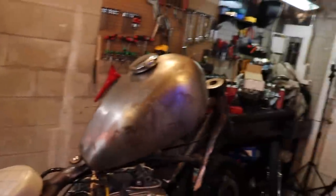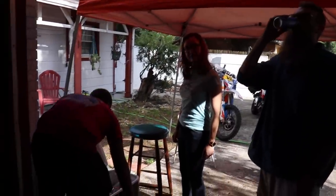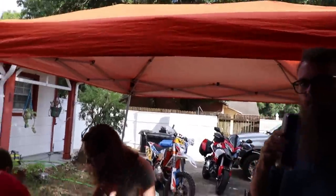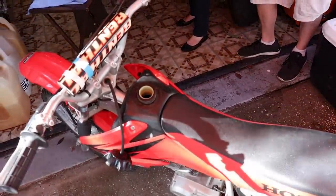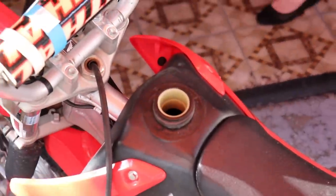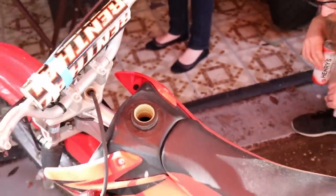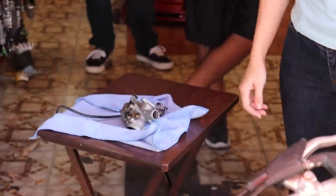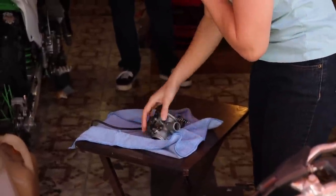We have multiple projects going on right now. We're working on the XS 650, Carlos is here, Dylan is here, Savannah's somewhere inside, and Sean and Erica just showed up. They came not only to drink some beers and hang out, but to work on the CRF 100 and actually get it running. The CRF is leaking gas — the petcock is bad, and the carb is getting jacked up. We have to assume something's in the tank. Since I put a Chinese carb I paid ten dollars for on the bike and it worked for a little while, we figured we might as well rebuild the actual carb that was built in Japan. Now we get to see Erica's very first time cleaning a carburetor.